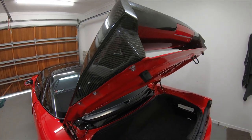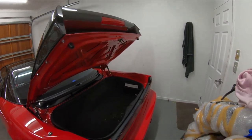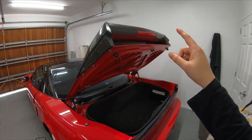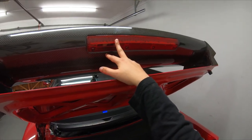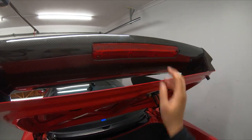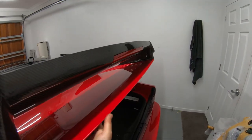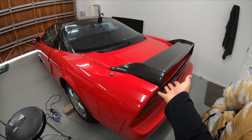The wing is installed — testing now. When I hit the brakes all three lights ignite no problem. But when the lights are on and I hit the brakes, only the bottom ones light up; the top one doesn't. I know we had similar LED issues with John's RX-7 stoplight and that was solved once the motor was running. I suspect once the vehicle's running it'll get enough power. My battery is also absolutely dead — we've been having problems with it for weeks — so that probably doesn't help. There we go, we have an installed wing.